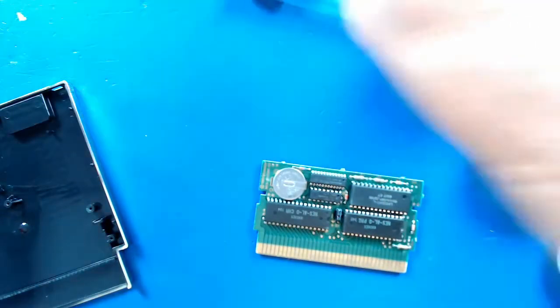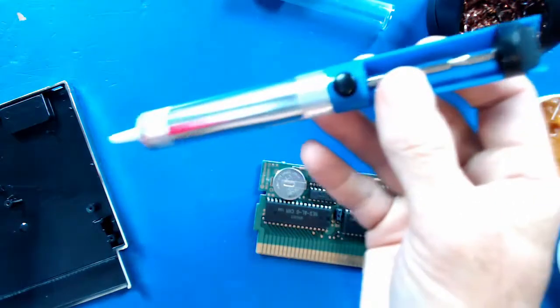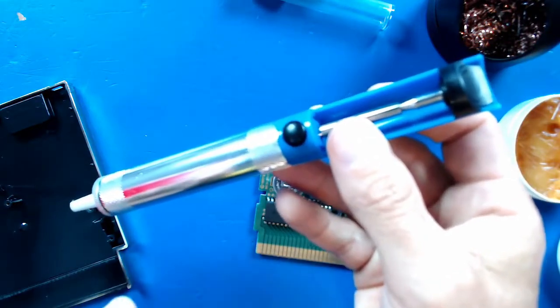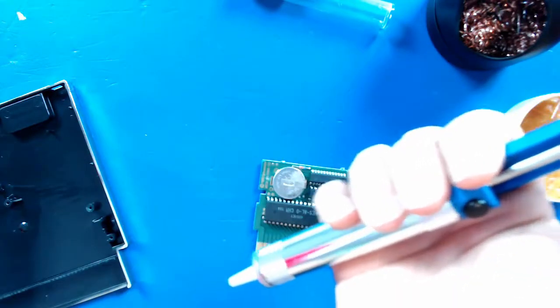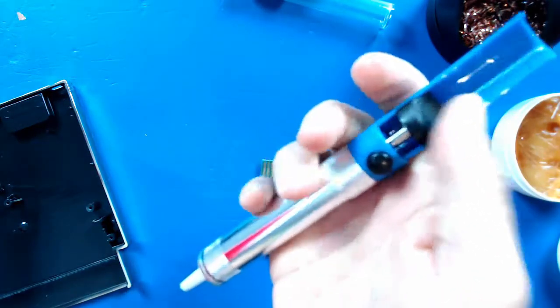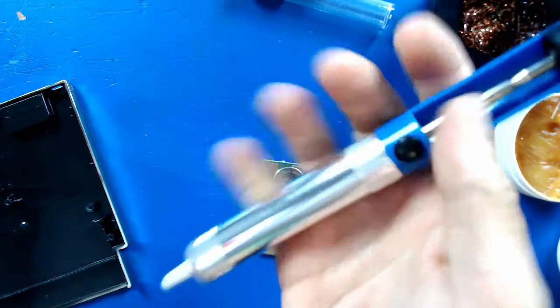Okay, so here's what we're going to be using. We've got just a little old solder sucker. You might have seen one of my other videos when we did the Joust battery replacement, actually, on the arcade game. We replaced the little 3 AA battery pack with a button cell battery, kind of similar to this. So I'll put a link in the description if you want to check that video out too. So anyway, same thing. We're going to use the little solder sucker here. Very easy. Push that down, and that sucks up the solder once you've heated it up.